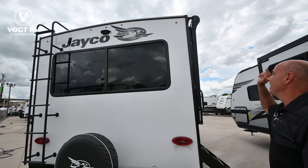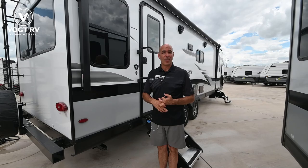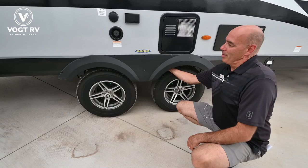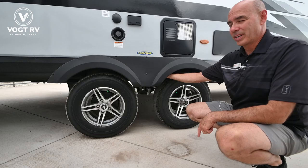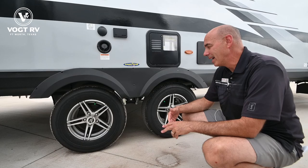Top that off — literally top it off — the roofing membrane of every Jayco starting in 2022 is the newest generation of Dicor, which carries a 20-year warranty. And I tell people when you're shopping: give the wheel wells the knuckle test. In Jayco's case it's going to be galvanized steel, so if you ever pick up a tread from a semi on the interstate, it's not going to tear up part of your trailer. It's reinforced — and that's something I wouldn't have thought about before my Jayco Masters training.